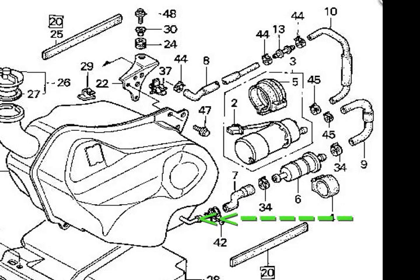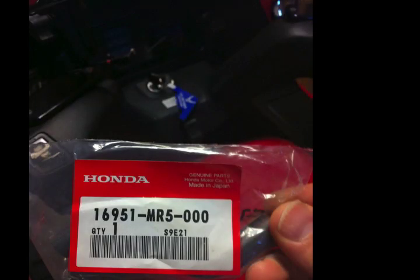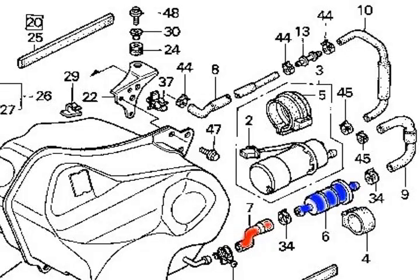The fuel on a PC is pumped out of a low point, seen here with the green arrow. Next, it goes through a black rubber hose, which I've colored red. Here's the part number for that rubber hose. Next, it goes through the fuel filter itself, which I've colored blue on this blow-up diagram.